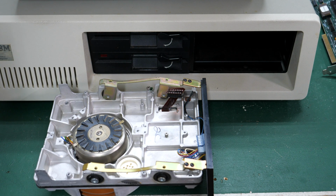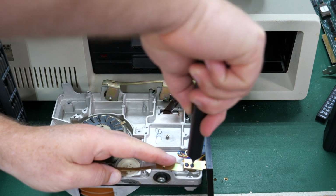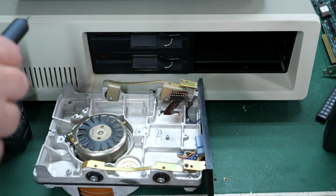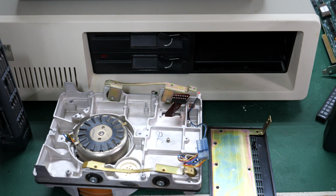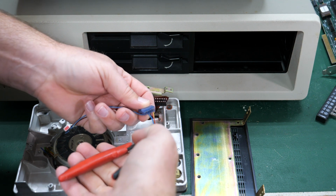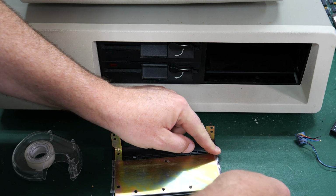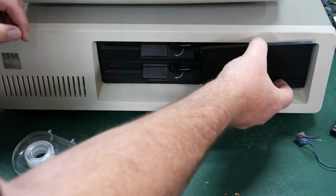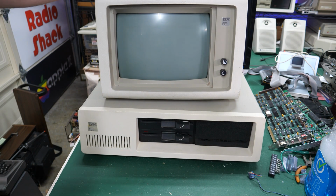Next, I wanted to see about adding that hard drive cover onto the front of the case here. So I found that on the underside of this drive, there were 4 little screws, and I could take each of those out, and that did leave a little bit of a metal piece behind, but that's okay. It'll support this cover nicely. Then I took some double stick tape and put it on either side and just pressed that into place. Again, not a permanent solution here, but it'll do for now, and later when I hook up an LED, I can easily take the cover on and off and make sure it's just right before I get it permanently attached to the case.